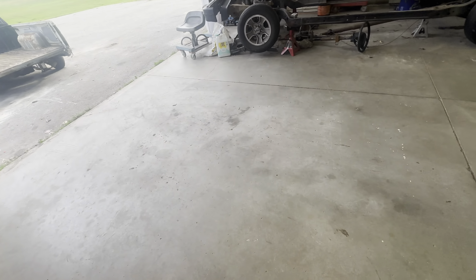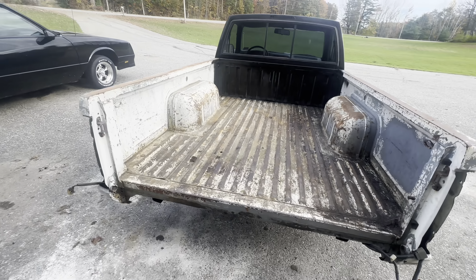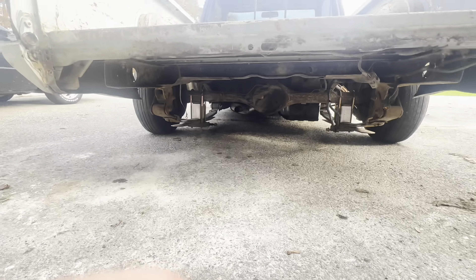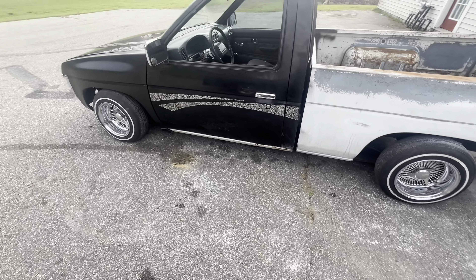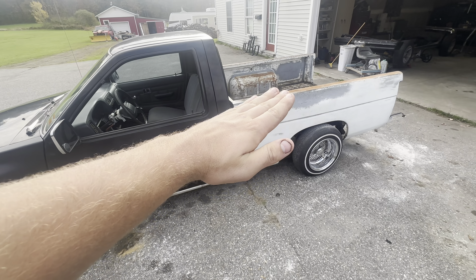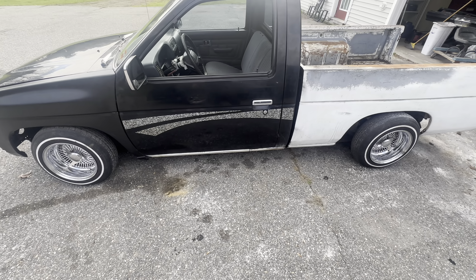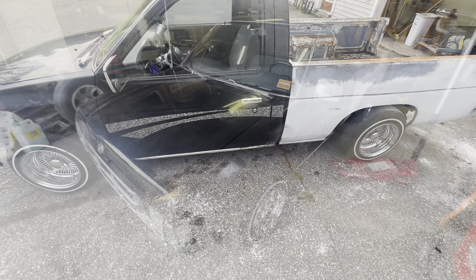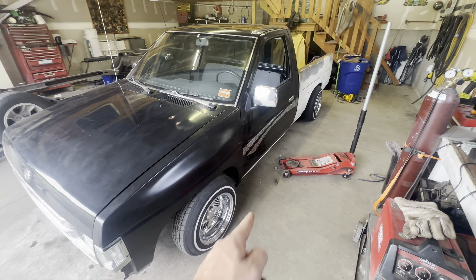I was pretty excited to start off the morning and heard a couple scrapes. I am destroying the ground - there's no way I'll be able to get this on the lift to get a front end alignment if I don't lift up that muffler. I was hoping it would be just high enough but once my body weight's in there it doesn't hold. I'm gonna go mess with that - maybe make a pie cut, bend the exhaust up a little bit, hold it back together. But now I gotta remake my hanger, which is a fat L.